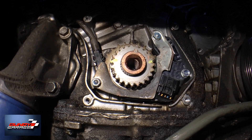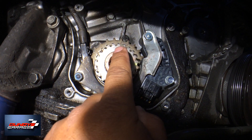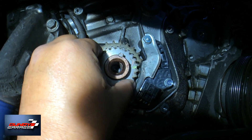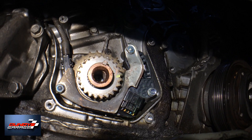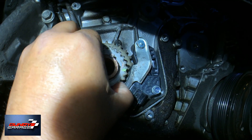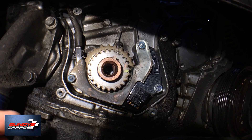I'm going to grab the belt, attach it, and rotate it counterclockwise until it gets to the 12 o'clock position. I thought about grabbing a large pair of channel locks, but I don't want to mar this gear at all. If you need to change out the crankshaft position sensor, it's right here — that whole thing right there is your crankshaft position sensor. So I'm going to bring this around, put the belt on, and rotate it counterclockwise to 12 o'clock. Double check, triple check before you put your belt on. Mark the front and rear cam on top in two places on the cam and the belt.